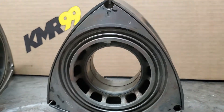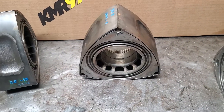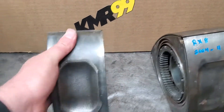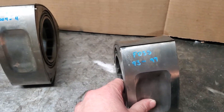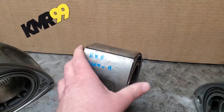They're also the lightest rotor from the factory, coming in at approximately 9.3 pounds, comparatively to a Series 4 rotor which is up closer to 10, or an FD rotor which is kind of in between those two. So lightest rotor, interesting seals — apex seals, side seals — and notching.